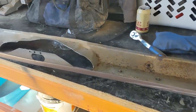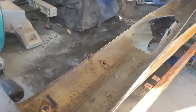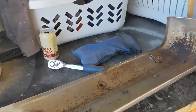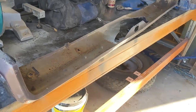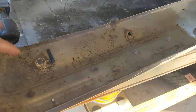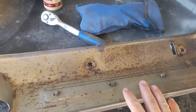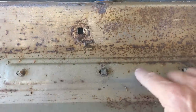It's come time to tackle this rear bumper. This is an HZ wagon rear bumper bar - they didn't come standard on the utes but I think they look better, so I want to try and fit this one. The brackets that came with it don't fit on the original holes on the ute, so to make it fit you have to drill a new hole behind one of the rubbers.